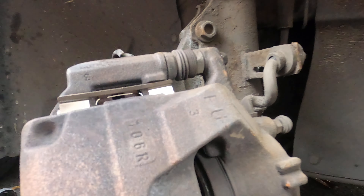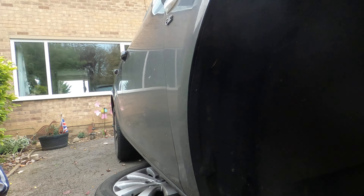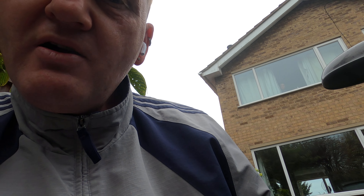And that's it - brake pads changed! All that's left to do now is to un-kink that hose - make sure you don't kink the hose. Put the wheel back on, tighten all your lug nuts up, take it off the jack, and torque your wheel nuts up. Start your motor and pump the brakes a few times to settle the new pads on the discs. Go for a little test drive - don't be braking hard like you're doing an emergency stop. Just do some light, gentle braking to break the manufacturing surface and bed them in. Once you've bedded them in for about 100 miles, you can do a cycle where you go to 60 mph and brake as hard as you can, back to 60, brake as hard as you can - do that three or four times. That'll put a good heat cycle through the discs and pads to help them bed in.